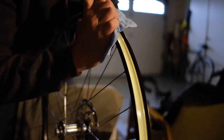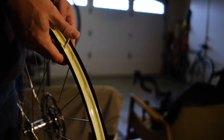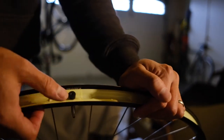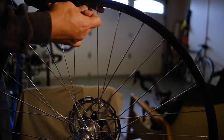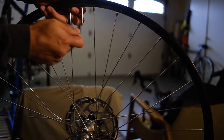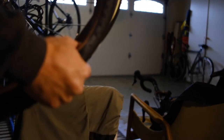Really take your time with this part — you might get some sore fingers. You can take a cloth to help with finger fatigue. Then take your tubeless valve and use something thin — even thinner than a pen — to find the valve hole and poke a starter hole through the tape. Push the valve through, making sure it's sealed really well, then push it in with your thumb and finger-tighten the nut. Don't use a tool to tighten the valve down because you could cause damage.